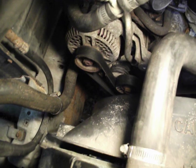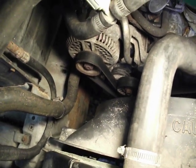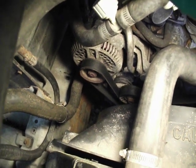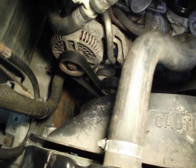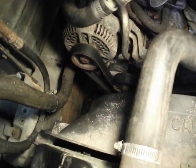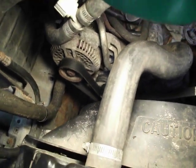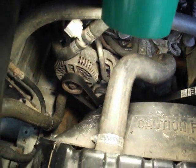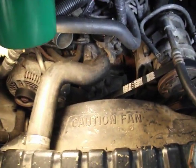You can see how different the routing is now. The smog pump probably does have to come off. In strict states like California you're technically not allowed to do this. You can also get a delete kit — install a pulley in place of the pump — so you can use the original belt routing. The cheapest pulley I found was about $50. This bypass method only requires removing the pulley from the original pump, not the whole pump.